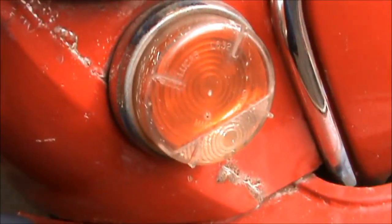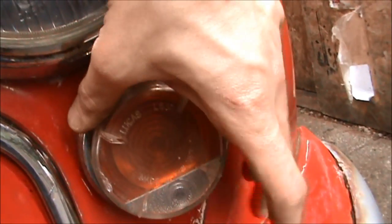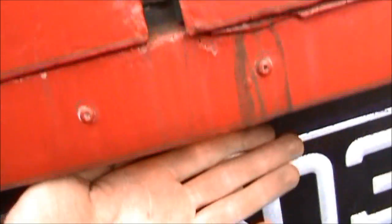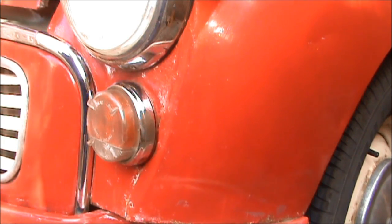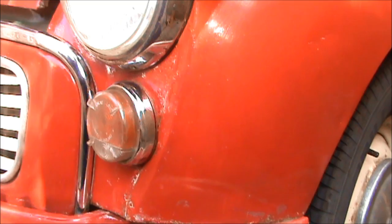This one isn't — I'm going to have to have a look and see why this light isn't on. The back ones are clearly working — that one and that one. If I put my hand on there you can just see there's a little bit of a glow on my finger where the registration plate lamp is also on. So I'll now quickly show you how to replace the bulb or see what's wrong with that one on the front side. As we've just discovered, the side light on this side of the car has decided not to work. I've still got the lights on, so I'm going to see first if it's actually the bulb that's gone or if it's something in the connector. Just needs to get these off — good grip, turn them, and they should come away quite happily.